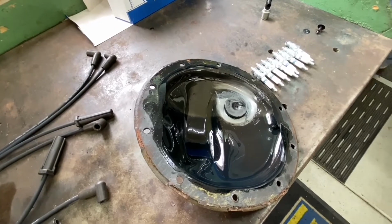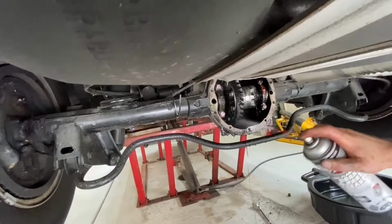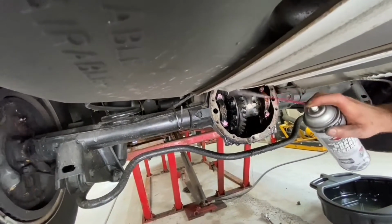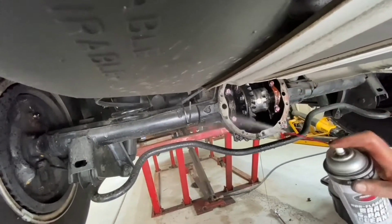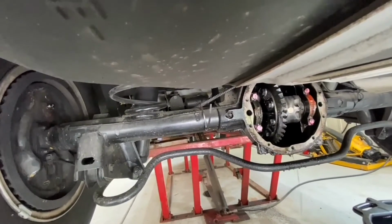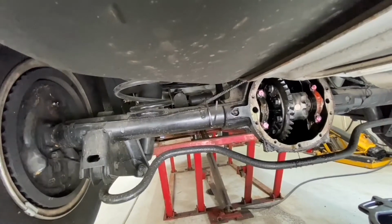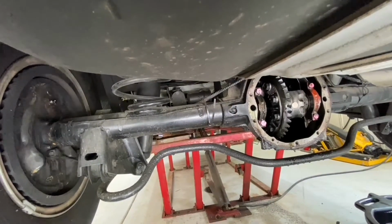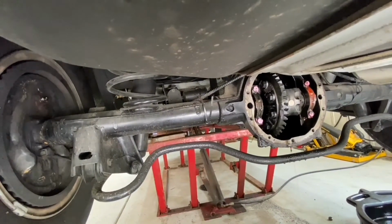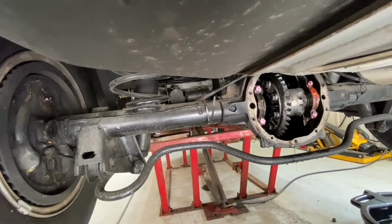It's sort of those mechanic things. They love cleaning off stuff. So this cleaning stuff is just because that's the way you roll? Mechanics roll that way. I don't get too carried away, just enough to get the debris away. Just get the gross stuff out, and then you clean the gasket surface real good so that it seals. It doesn't really have a gasket, does it? It had a felt. Not a felt. You just use RTV? That's what I'm going to do, yeah.